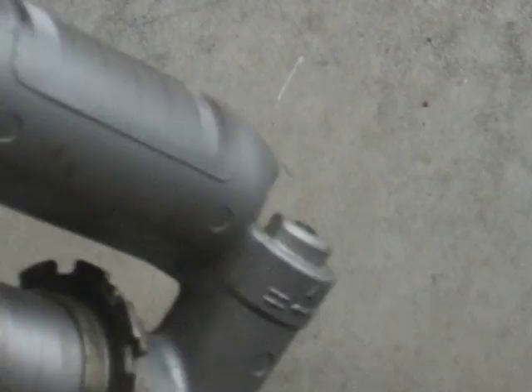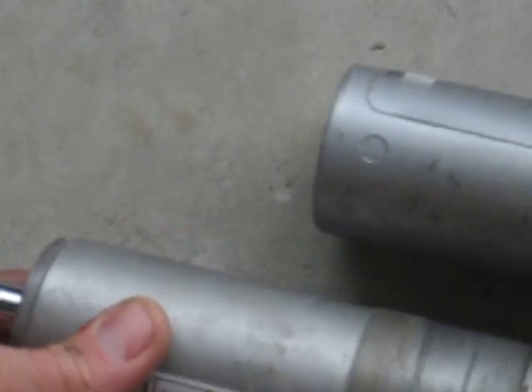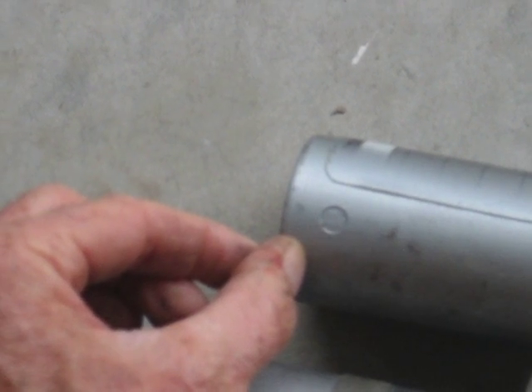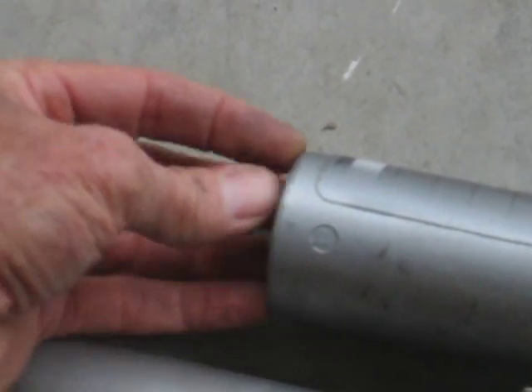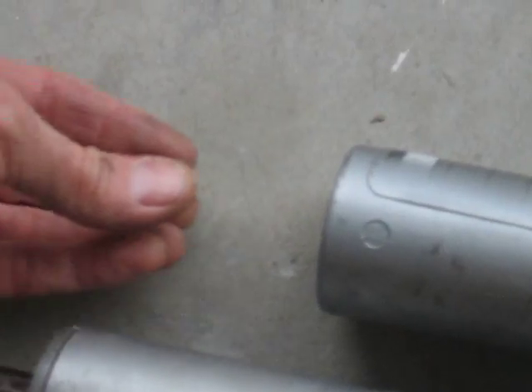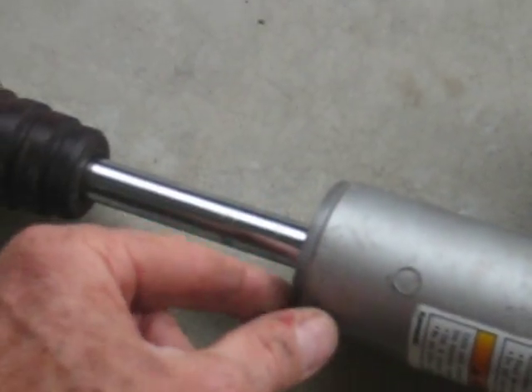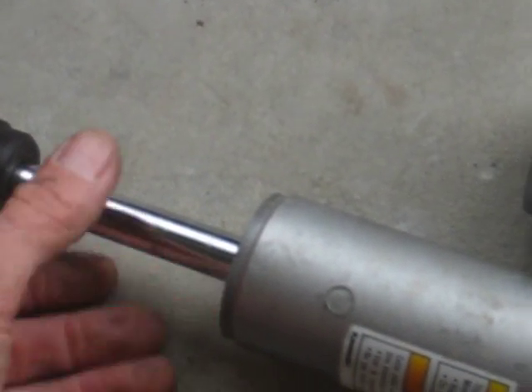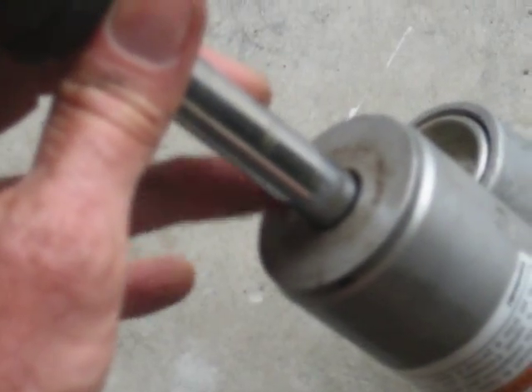It's really important because you won't even be able to take it apart otherwise. When I bleed the nitrogen out, I'm going to compress the end cap down about a quarter inch, because inside there's a little round circular snap ring I've got to pry out. Then I'll take the bladder out of the reservoir, and I can do the same on this end — pop the little cap off, compress the seal head which is down inside, and I'll show you that in a minute.